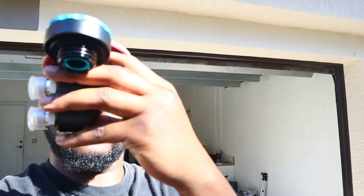So this is how this thing looks — I have all the O-rings on it. Now I just have to take off the oil cap. I don't have a 34mm socket, which is what you need to tighten this black piece down because the top piece separates. I'm gonna make a pit stop to AutoZone or Advanced Auto so I can buy a 34mm socket. I have a 32 but a 32 definitely won't fit.